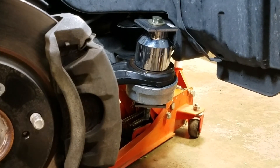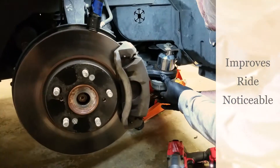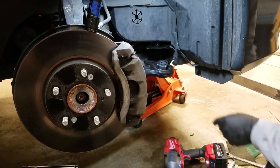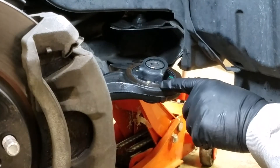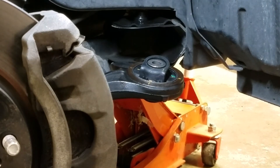I'm going to take this homemade press out. The bushing's installed. I look at my clock positions and they're exactly right. It's above the control arm just a touch. This is done — put the control arm back.